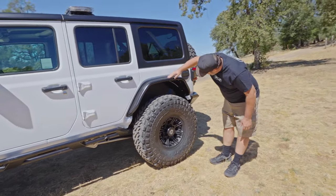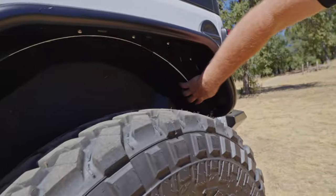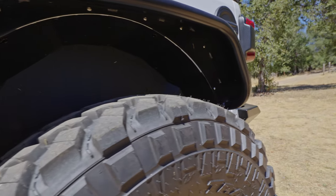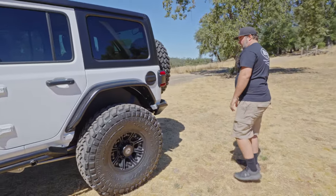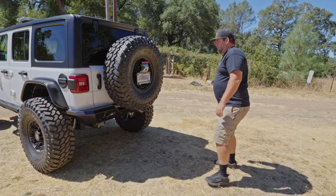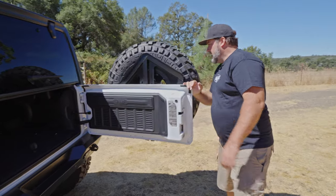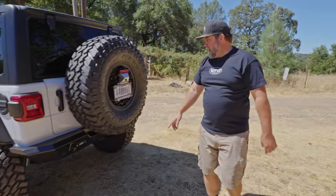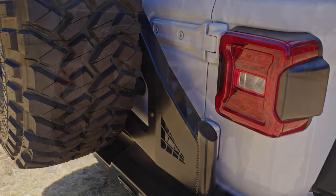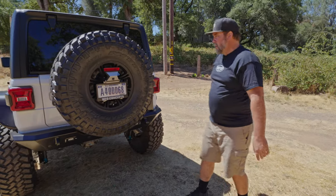Genrite fenders in the rear as well, and again American Adventure Labs inner fenders, which have been modified — cut, stretched, and reattached to fit the 40-inch tire in the wheel well. It's these little details that make a really cohesive and well-operating vehicle. On the rear, Rage 4th rear bumper, and we've done some creative work to mount the 40-inch spare on a swinging tire rack that is frame-mounted — an old Poison Spider swinging tire rack. Rigid backup lights are hooked up to the actual reverse lights in the vehicle, and we moved the license plate and camera to the spare tire.